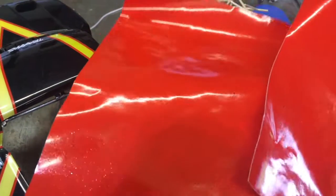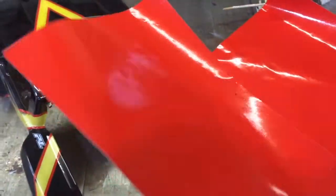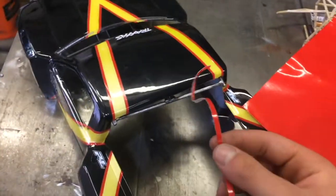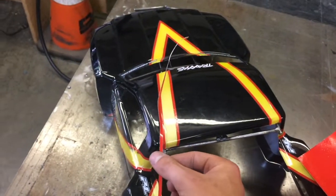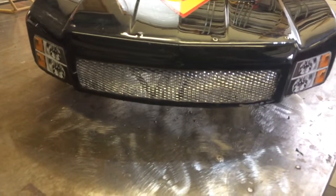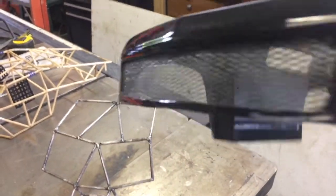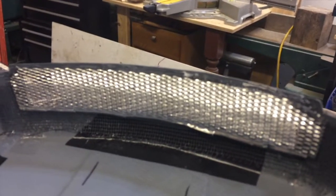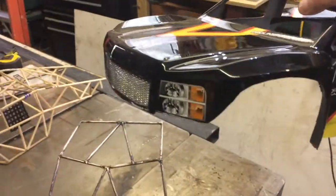The red vinyl has a little metallic in it. The finish looks a little dull but when you look at it closely you really don't notice it — it blends right in with the polycarbonate body. I also want to mention this beautiful grill, which is made from just one sheet of mosquito window screen, and behind it is the corner bead you'd use on sheetrock — I just cut it up and bent it to the body. It really completes that rugged look.